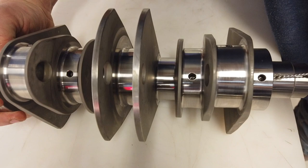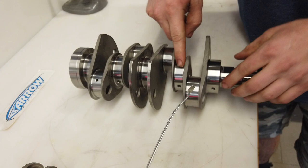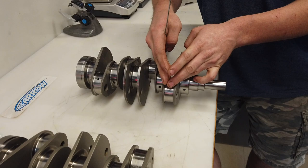That means here is a complete oil channel, and this oil channel goes straight to this channel. That means that these two bearings feed the oil channel flow for the big end bearing on cylinder one. That's pretty good, because when you have a problem here or here, there's a little bit less pressure. It is also much safer like this, if you have only one bearing bringing pressure to big end bearing one.